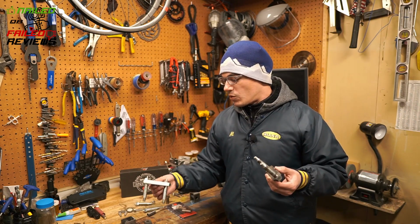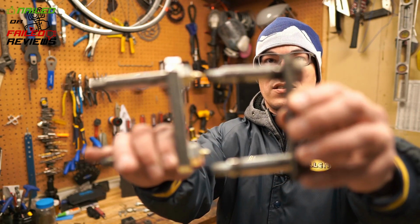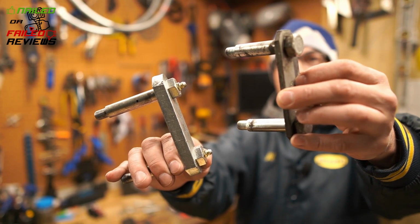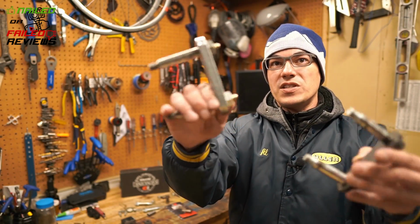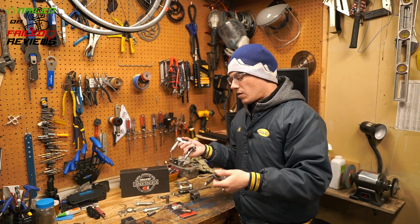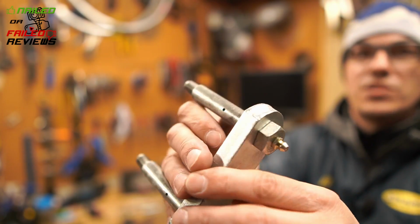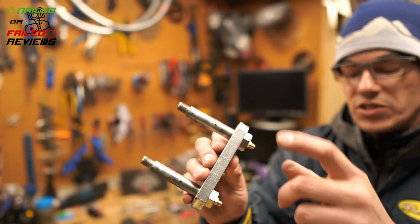The wet bolt heavy duty shackle kit from Dexter, again, is this. It is basically an upgrade kit so that you can go from this little flimsy looking quarter inch thick steel plate to this half inch steel with wet bolts. So you can see it's obviously a huge difference. The bolts are the same size, but they're wet bolts. You can see there's a Zerk on the end that you can attach a grease gun to, and then you can see the little hole there that the grease will come out of.